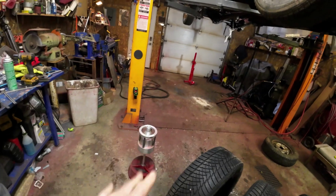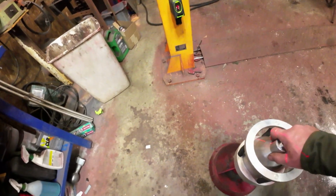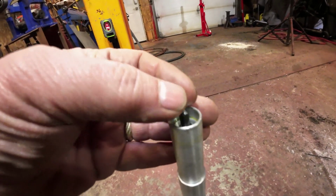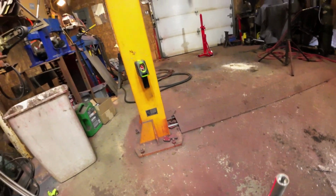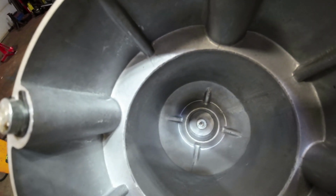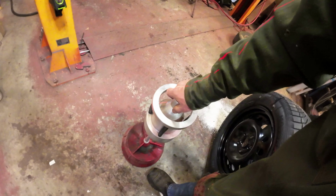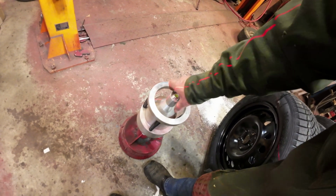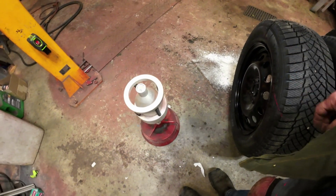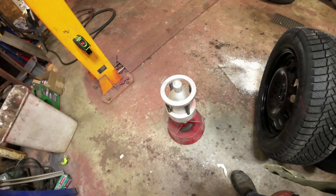Anyway, that's the balancing thing. Seems to work pretty nicely when it's figured out. I'll just show you here underneath. This part here comes off, and it just sits on that little tiny pin right there. Can you see that pin? That little pin is a hardened steel pin, and it sits up inside here, and the hole at the very top wasn't big enough to allow the thing to shake back and forth, or to wander back and forth. So it's not going to do that. If you get one out of the store and put it on and it doesn't do that, then that hole's not big enough, and you just make the hole bigger, and it works great.